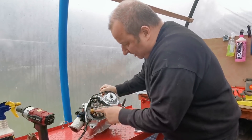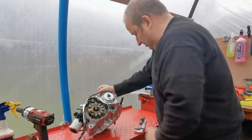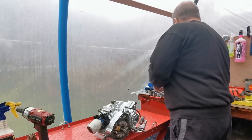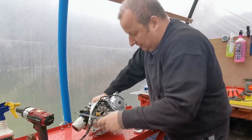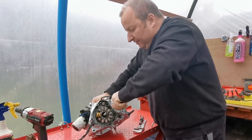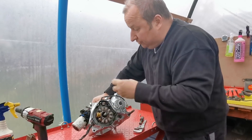Looking in there, there's our stator which has got to come off with them three screws. We've got JIS screwdrivers for that - blue handles, that's the kiddies. Right, we just crack them JIS screws. As this has been apart before - we can tell that because one of the nuts on the other side is rounded off.